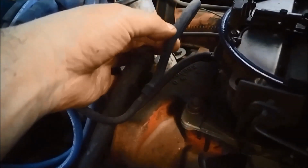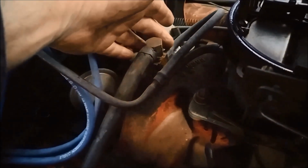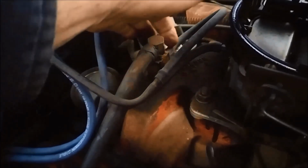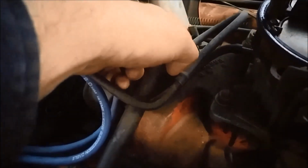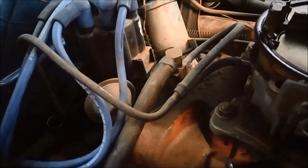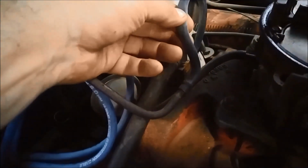Also, sometimes they put the wrong hose on them, and these hoses collapse under vacuum, especially from the heat of the motor there. And also the little port there, the little T-piece, or T-tree, or whatever you want to call it, the little port sometimes carbons up. They have like a little restrictor plug in there. Sometimes they're open right through. Sometimes they have a little restrictor, so they have a 1/16 size hole. Just make sure it hasn't carboned up or anything like that. So we're going to replace this hose with a proper vacuum hose.